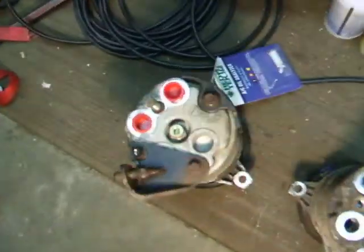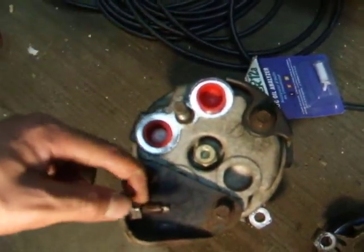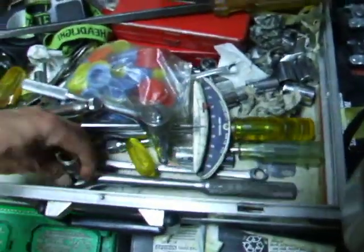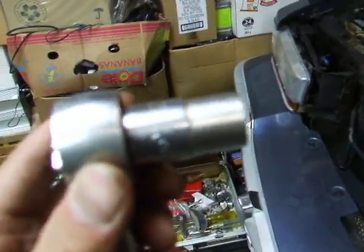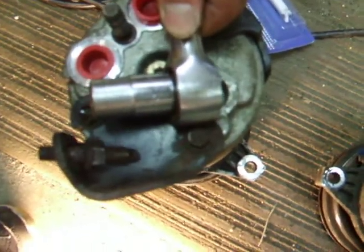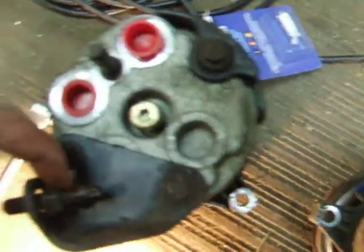So I thought, what have I got to lose? I went up on top and I took off the refrigerant hose and tucked it over behind the dipstick line, then I looked down. If you look down in there when it's installed, you'll be able to get at the bolts. I managed to get at the back bracket and the stud, and got the nut off the stud. A 3/8 drive shallow socket was too short; a deep socket was too long — it hit the frame. So I ended up using a half-inch drive 9/16 socket, which was just the right length to clear the stud and not hit the frame. Real tight in there.